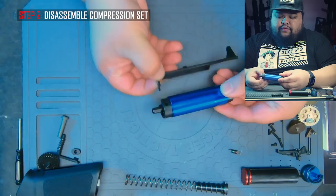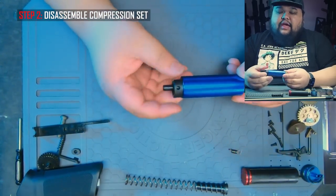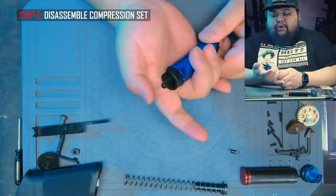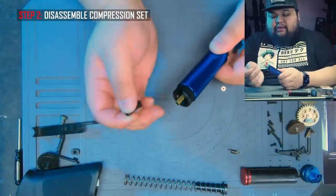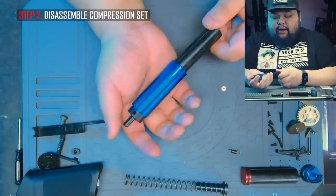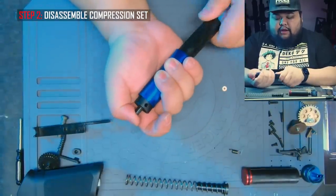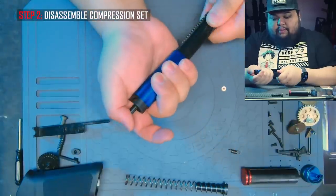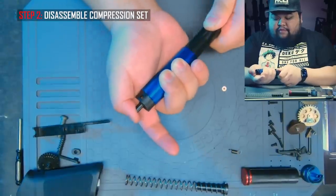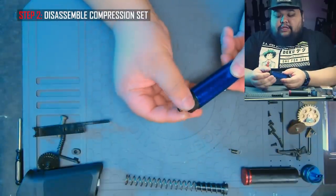I'm going to remove the tappet plate, set it aside, and test the original compression set to see how well it's working. Hold your thumb over the air nozzle and the cylinder head right there, then take your piston and push it forward. Keep in mind if you have a port, the compression will start after the port. So hold it down and push. Oh, that was actually pretty bad — it's giving quite a lot of movement. You're not supposed to be able to push it through. There is an air loss here somewhere. To target where the air loss is coming from, I'm going to remove the air nozzle and put my mouth directly on the cylinder head.